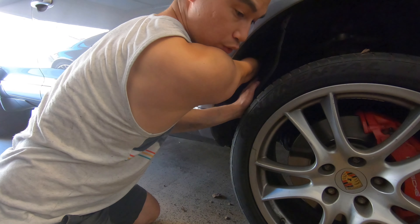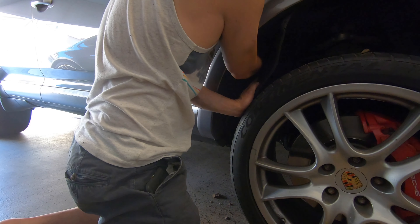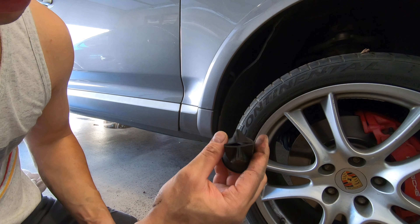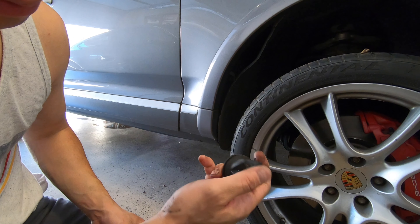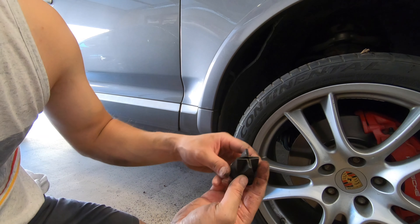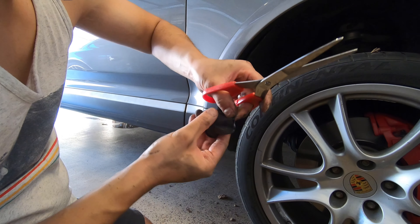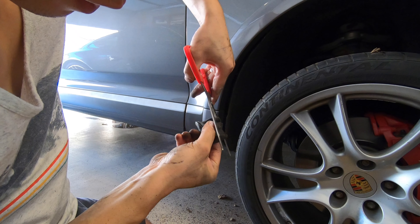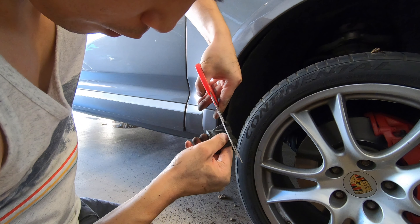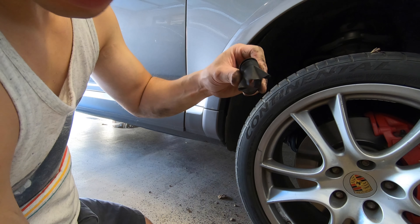If you stick your hand through you'll definitely feel the plug, and then what you want to do is just pull that out. We have the drain port here that's designed to keep things from getting up into the front cowl. However, as you can see, it's pinched off, so as leaves and other stuff get in here it's going to keep water from flowing out and cause water to get back into your cabin. We're just going to snip off the tip — this gives us a bigger opening and prevents the port from getting clogged.